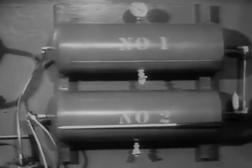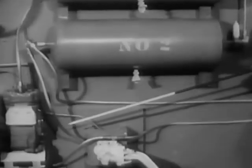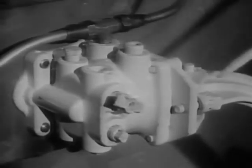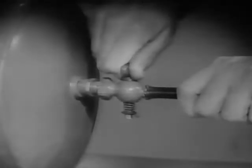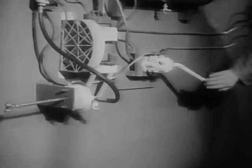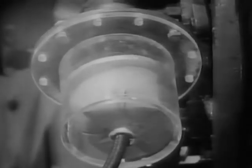Compressed air from the reservoirs goes to the brake valve, which is operated by the foot pedal. When the valve opens, air is permitted to rush from the reservoirs through the brake lines into the front and rear brake chambers located close to the wheel. Each brake chamber does the same job as demonstrated by the rubber balloon.